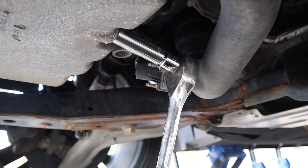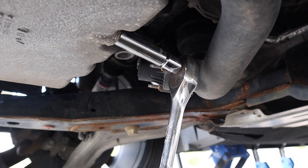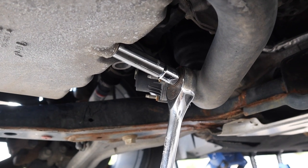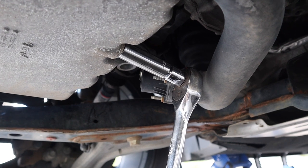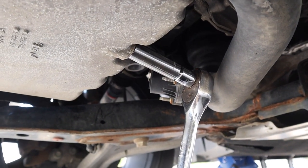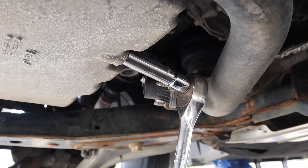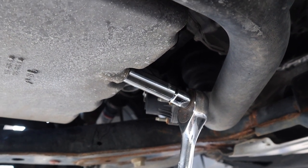All right, so the drain plug is a 15. There is no visible drain plug washer on this car, and the last oil change for this vehicle was done at Lincoln itself. So that means this is just the way it is. It's very light aluminum stuff. Do not over torque this. Not that you'd over torque any drain plug, but use a torque wrench if you're a bit more scared of your abilities. 20 foot pounds, if not, just snug it just a hair.